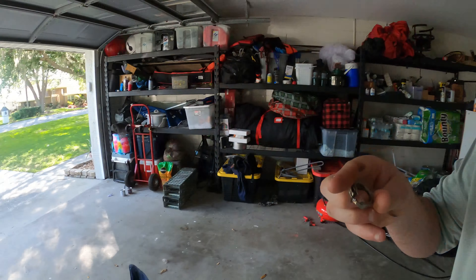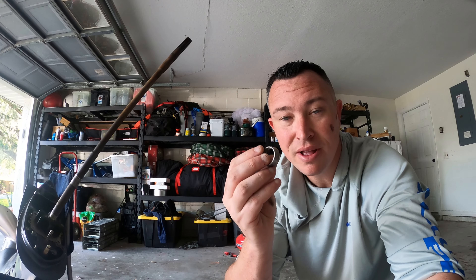It's been a few days. This ring absolutely sucked — on the first motor I was able to get it off, but on the second one I just could not get it; it banged up my knuckles. What I ended up doing is ordering a new ring through Amazon for twenty dollars. I took a Dremel tool and cut right here, avoiding cutting the shaft. I'd recommend just buying an extra one to be safe — twenty bucks still saves a lot of money.